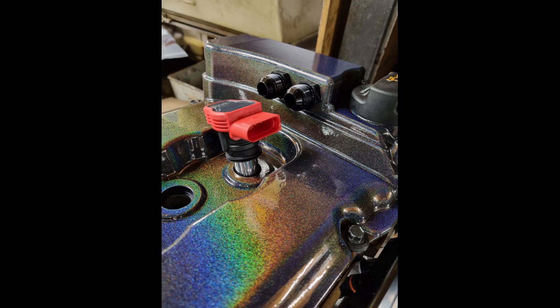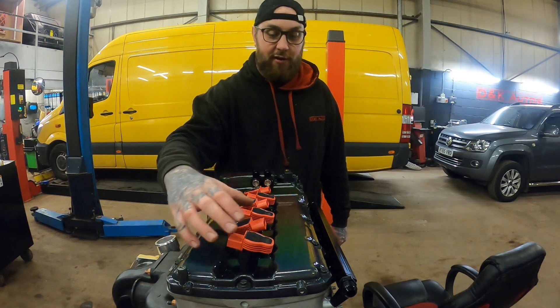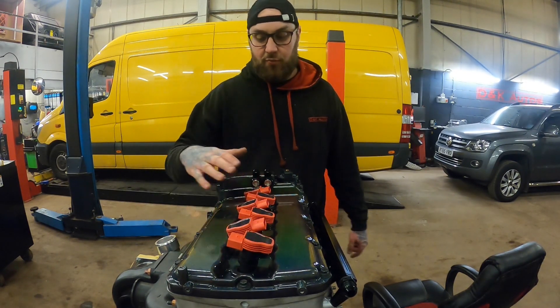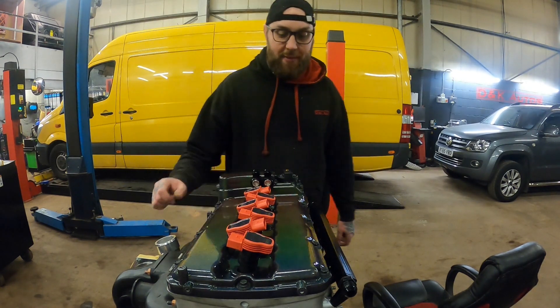There's a photo of when I had the straight fittings — not only did they stick up too far, but that's with the coil pack all the way down on top of the spark plug, so it physically can't go further down. You can also see where the coil pack goes into the cam cover there's a silver bit — the heat shield — showing because the coil pack isn't going all the way down. What I've done is cerakoted the top half of the coil pack in black so where it does stick out it's not silver and doesn't stand out. Now it all just looks black around the edge, more stealthy.